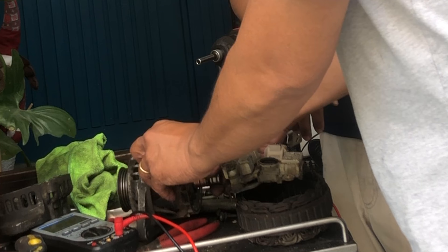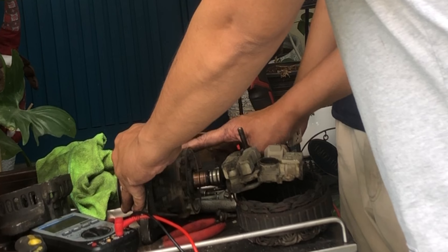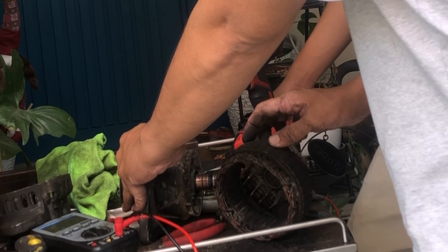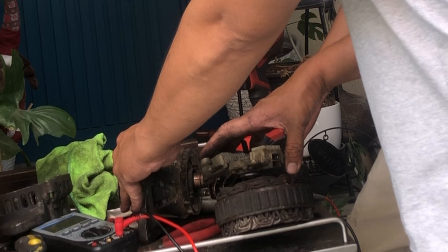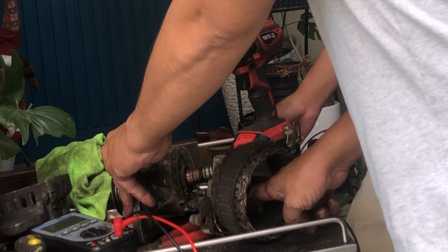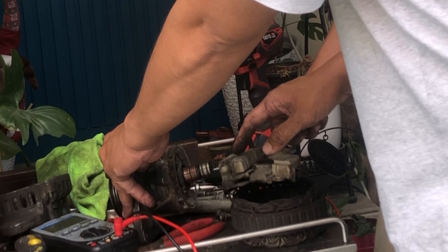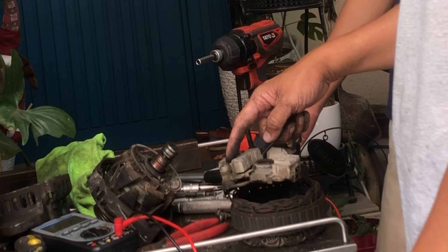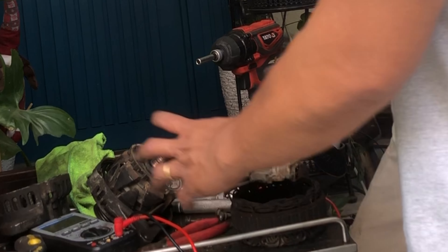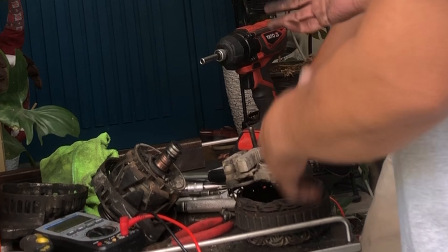So that's it - so how does this work? You put power in this and then this becomes magnetic. When you spin the magnet, it will transfer energy to the stator windings. This produces electricity - AC, alternating current - so it doesn't have a positive and a negative. Then this goes to the diode, and that's when the magic happens where AC turns to DC. It will now have direction, flowing in one direction. The positive goes here, and the negative will go to the body. The whole body will be the negative, then goes to the body of the engine, and then goes to the battery.